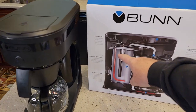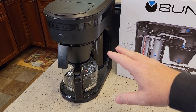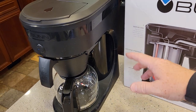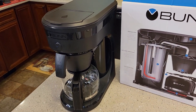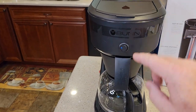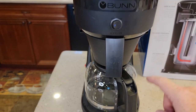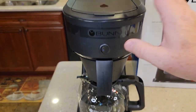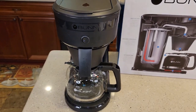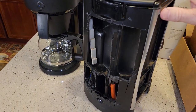You've got to wait 15 to 20 minutes before this tank gets up to temperature. That's the downside of Bunns — if you accidentally turn that vacation switch off, it takes 15 minutes to warm up the water inside that tank. You're going to hear the water boiling in the back; it'll get a little noisy and that means it's doing its job. This other switch has a really dim LED but that's only for the warming plate, so since we don't have any coffee just leave that switch off right now.